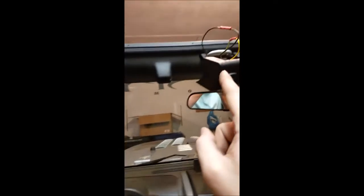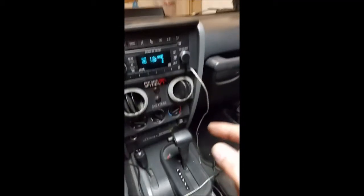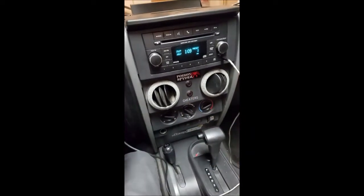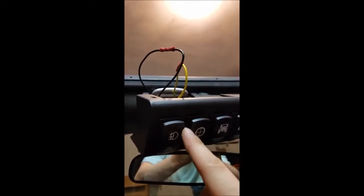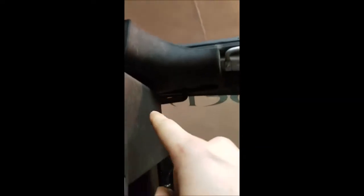Using the 'Over the River and Through the Woods' switches — they have a 4 or 5 prong configuration; I showed you the diagram. On the lower right, that's going to be your power for the lower LEDs. The top left is going to be your ground since we're on the opposite side. I daisy chained all of those together for the power as well as the ground. I ran the ground over the windshield, down the A-pillar, and then tapped into another ground I have down in the footwell lighting. Your radio and a lot of other stuff grounds there — it's pretty easy to find a ground right there.